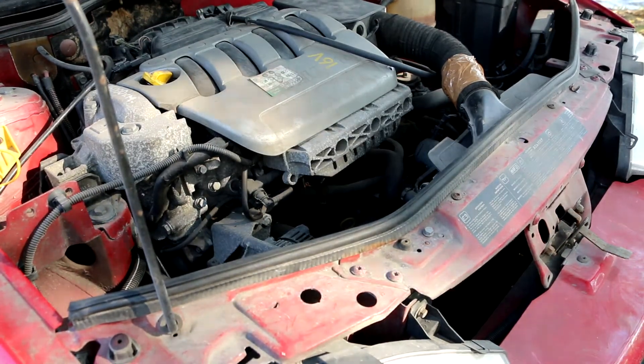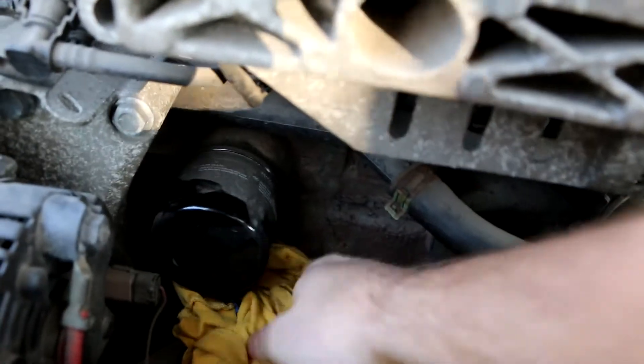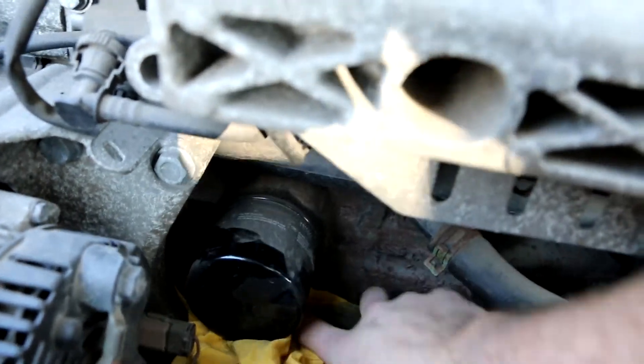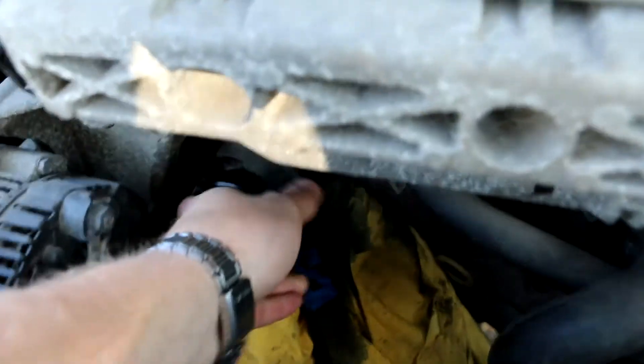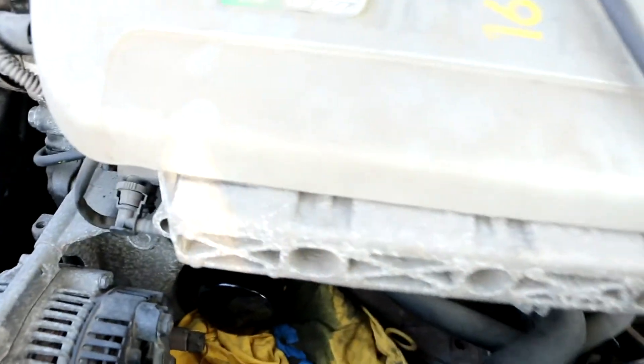Next, move on to the filter. The filter is located right here. You may be able to open it by hand, but before you do, take some old rag and put it under there and tuck it down because oil will definitely leak. You don't want to make too much mess — just nicely snug the rag around there and the oil just sits in. Then turn anti-clockwise to open. I used a filter wrench clip — attach it and undo it.